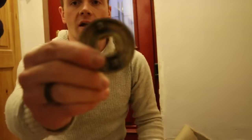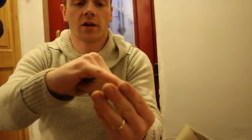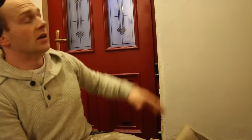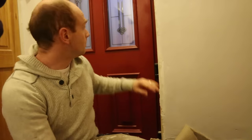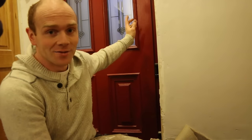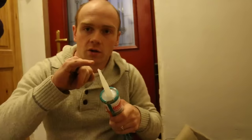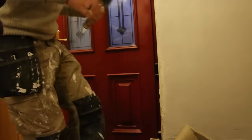All I'm going to do — like fitting a tap on a sink — is put a little donut of sealant around there, because this is a really airtight, nicely sealed door, and the last thing I want to do is leave holes in the new door. Just those two six-millimetre holes — I can already hear more road noise coming through than before — so I want to make sure they're all sealed as much as possible. A little squidge around that middle hole as well.